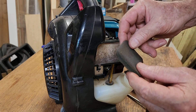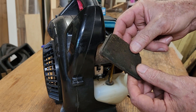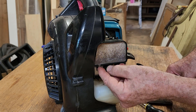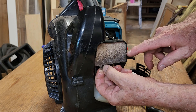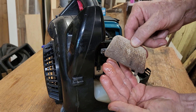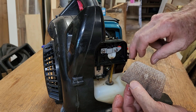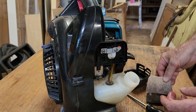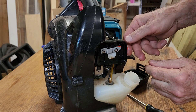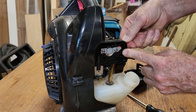There's our air filter — it does look a little dirty, but that's not too bad. That's a foam pre-filter, which can break down as they get older and start to fall apart, but this one feels pretty good so we'll just give it a wash up. There's a main air filter behind that and it looks quite soaked in fuel — it's quite oily, but that's not such a bad thing. We'll wash that out as well, so the air filters just need a wash up.